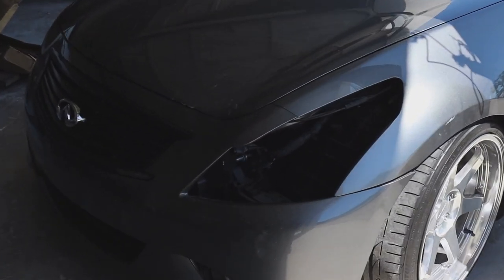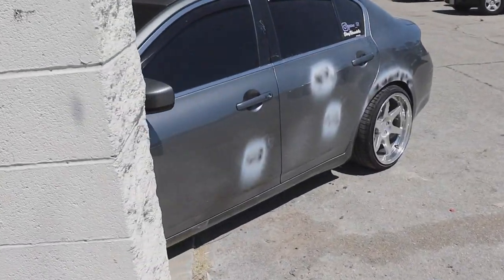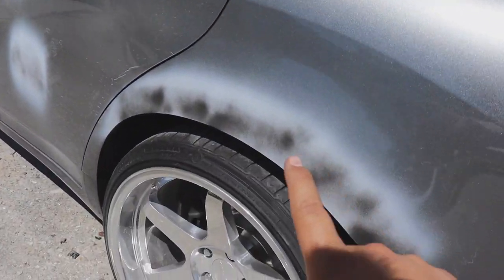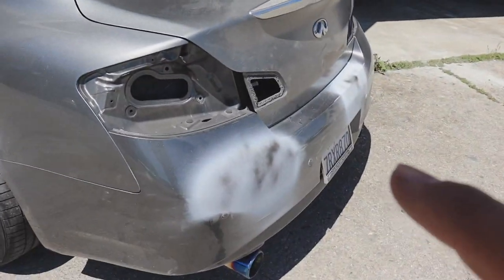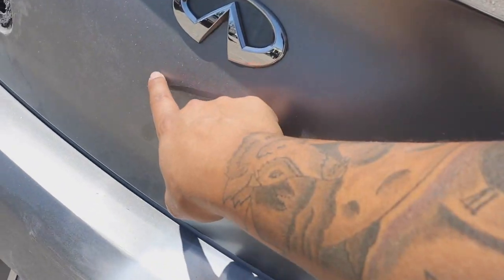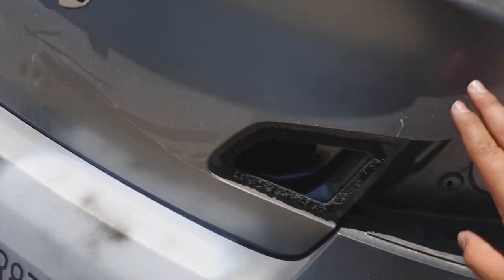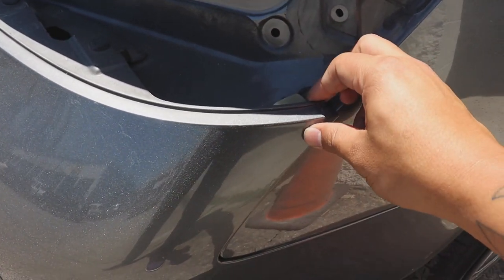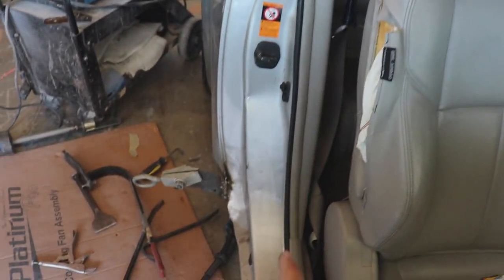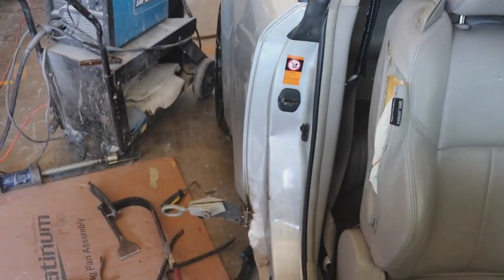Here's a little progress check. We popped the headlights off the G37 and started working on the back panels — it has a few small dings on the doors, like shopping cart dents, that we're fixing and rolling out to make it even. We also popped out the taillights. The back bumper had the damage we mentioned, and the trunk was already resprayed by someone else, so we're fixing that and patching the emblem area. On the G35, we're realigning the door and the hinges, and pulling out the front to straighten the pressure points.